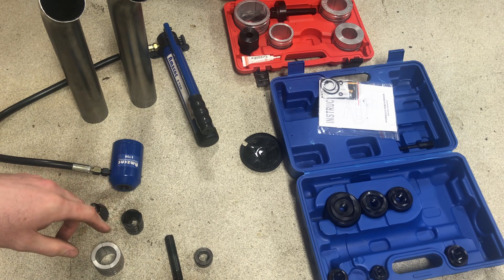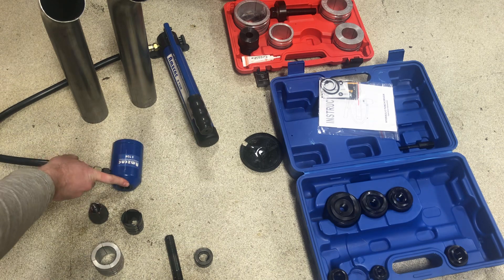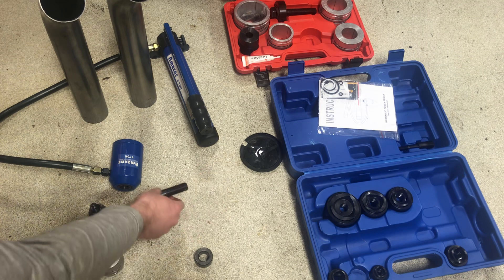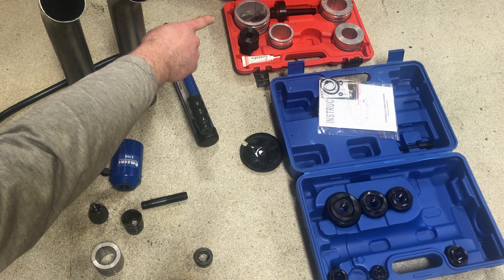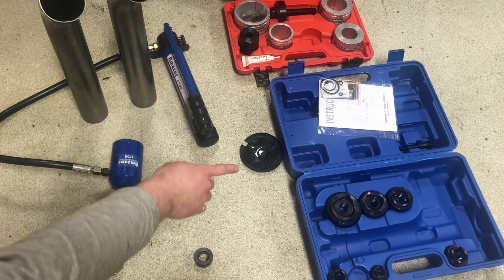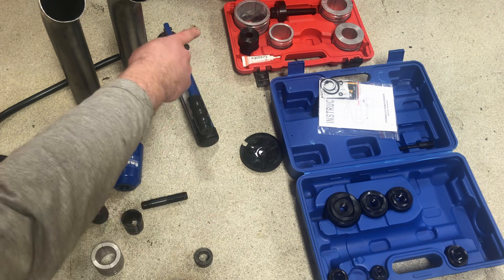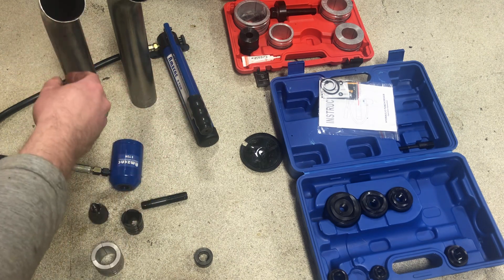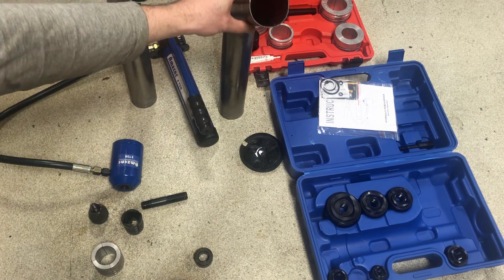That's what's shown in blue. They give you the hydraulic pumper, the cylinder, and the threaded pull stud. The threaded pull stud is the same thread as the exhaust expander, which you use with an impact gun or something. So you use a combination of the electrical conduit punch kit and the exhaust expansion kit, and together they make a hydraulic flaring kit that flares the pipe.